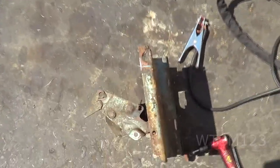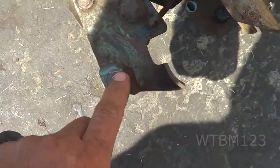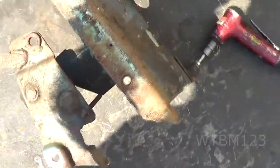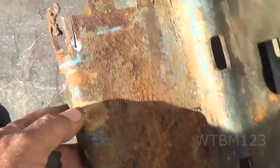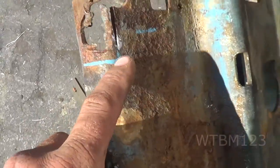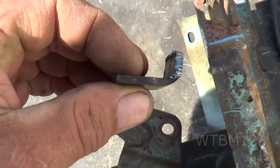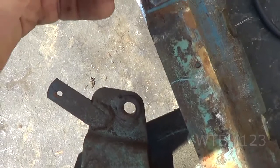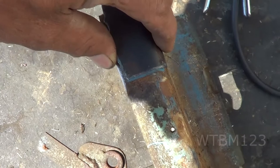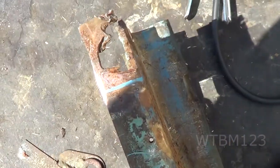We're doing a little bit on the Sears today. This bracket is for the clutch — see how that's raised a little. I'll tell you something about that pulley in a minute, but this is what I got to start with. I'm just gonna cut it out where that paint mark is, then I got this piece which is not quite as thick but has the same bend, so I'm just gonna weld that in there and call it good — just make sure the outside surfaces are flush.